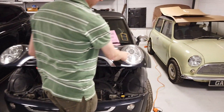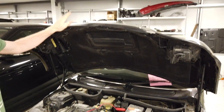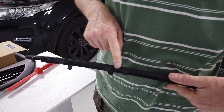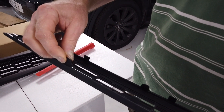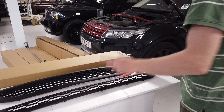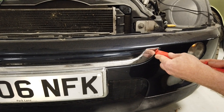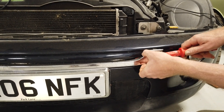On the early models the headlights go up with the bonnet; on later ones the headlights stay in place. We've got two grills — upper and lower. Looking at the lower grill, it has a series of little tabs with a ramp on them, so it's just a question of ramming it out. Some tabs might break on the old one. Let's get in from the side — there you go, working along the clips.